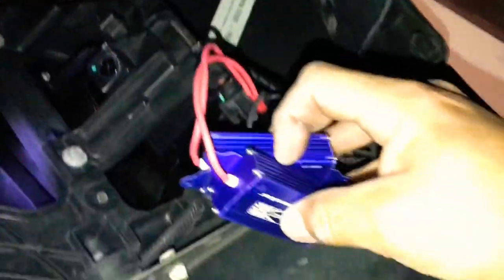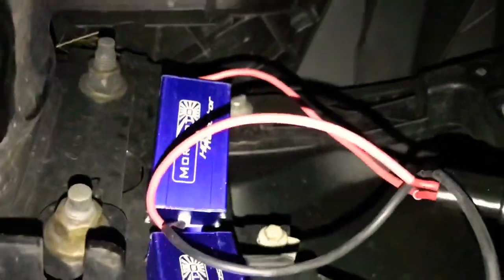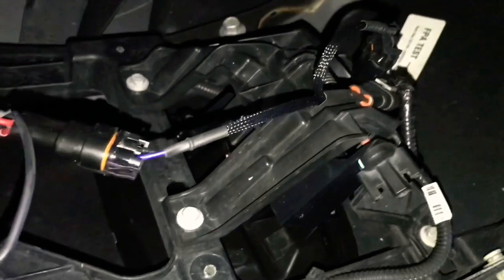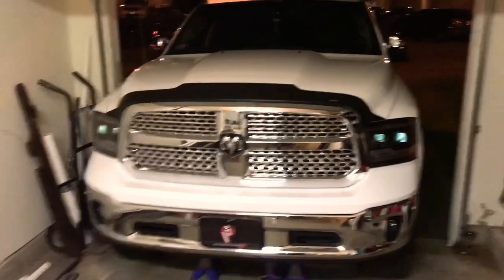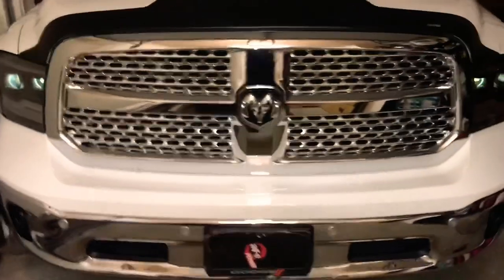It comes with a harness and wire splitter — make sure when you put these wires in they line up with this plug. This plug will plug into the resistor, and once those are plugged in you're all set. This plugs into the truck. Fog lights back in — tighten these bolts up, nice and easy. If you've got a power tool don't wrench it; you don't want to break anything. Nice and snug. I'm going to zip tie these resistors somewhere. It says on the back these get really hot, so mount to a metal surface only. I put a screw and mounted them both at once — bent them out a little bit so they don't vibrate. Now the Morimoto headlights and fog lights are installed.